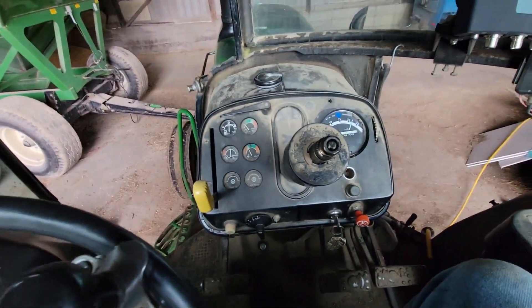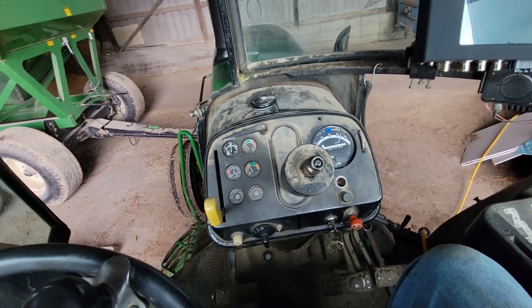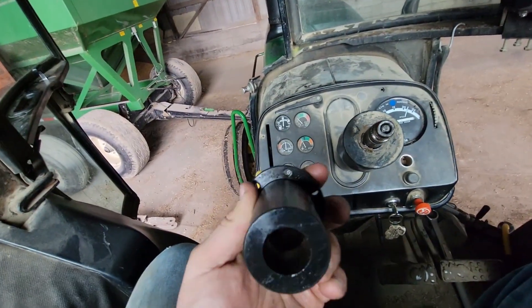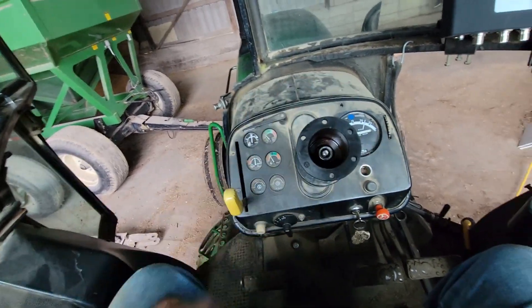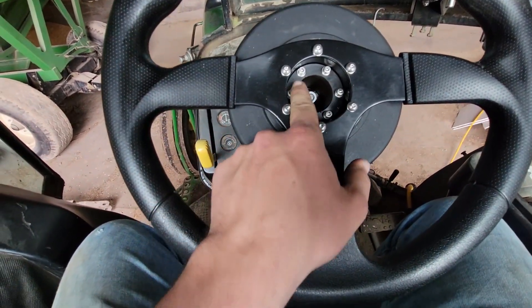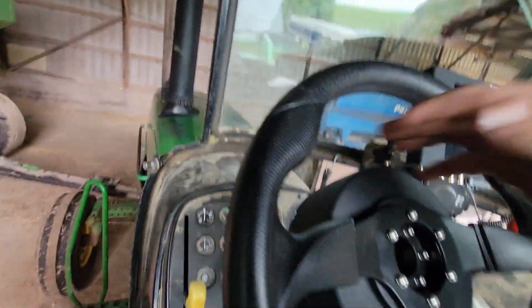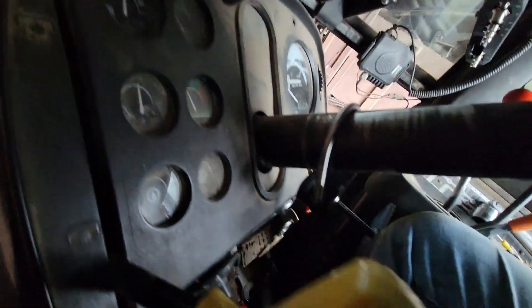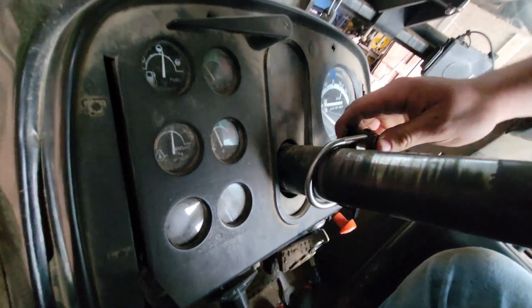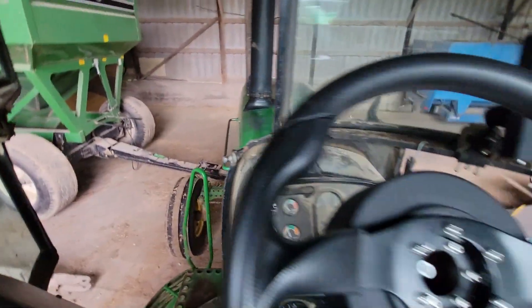After completing an emotional experience, I have managed to get the steering wheel in my hand — it's been there since '82, I almost guarantee it. I've concluded that number four sleeve is the one that fits on here. I got the wheel slid over the shaft — you take your sleeve and there's six little Allen screws, you screw it to your wheel. They've got probably four or five clamps because you've got to hold your motor steady. There's a little E-clip in there you've got to take out and a plastic little sleeve to remove, but it's not a big deal.